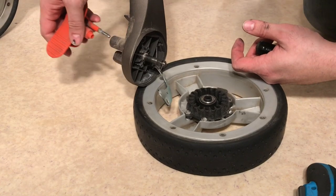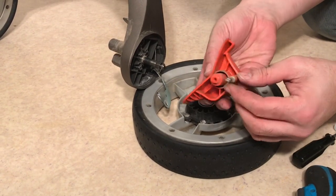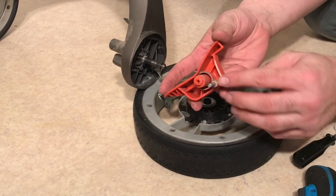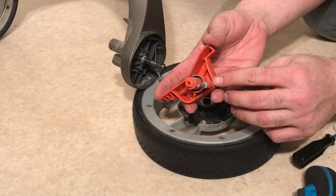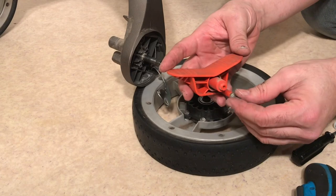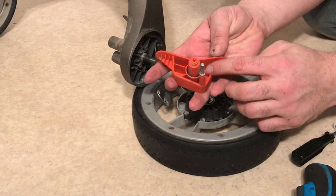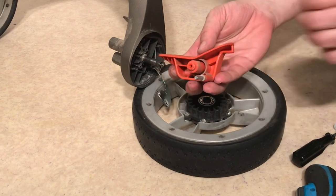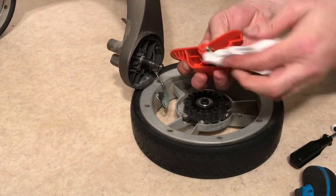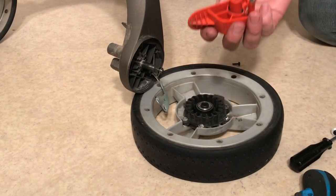At this point you could actually pull the entire pedal out. If the pin is loose on this piece it means you'll have to replace the pedal itself, because the pin is entrenched into this little plastic tubing. You do want to check that the pin is not loose here, and you'll notice there's quite a lot of dirt and grime that can tend to build up over time. If you're having trouble with the brake system it's not a bad idea to clean all of that out.